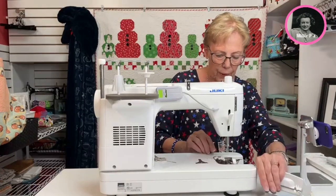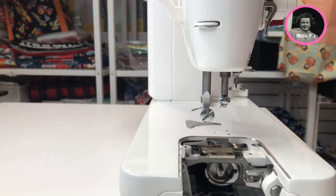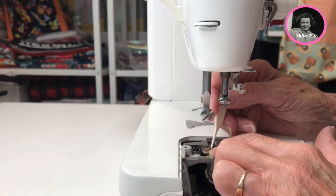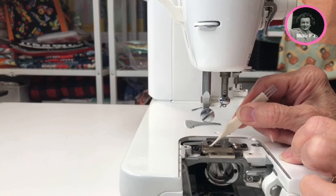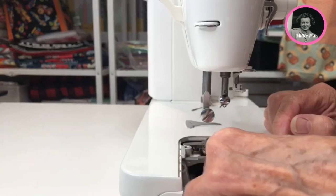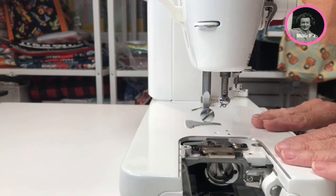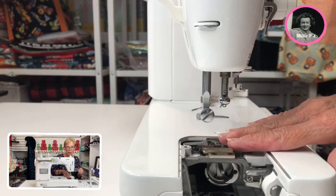This whole piece will come off, so then underneath you can see — this machine hasn't been used a ton. We've got the little brushes that come with the machine, and you're always going to want to make sure you get all this cleaned out. There are slots in between the feed dogs — make sure you take your little brush and run it right in there to clean out. If you have a lot of fuzz, that'll just pull it right out. Never ever under any circumstances blow into your machine — by blowing in, you'll pack it somewhere you don't want it.